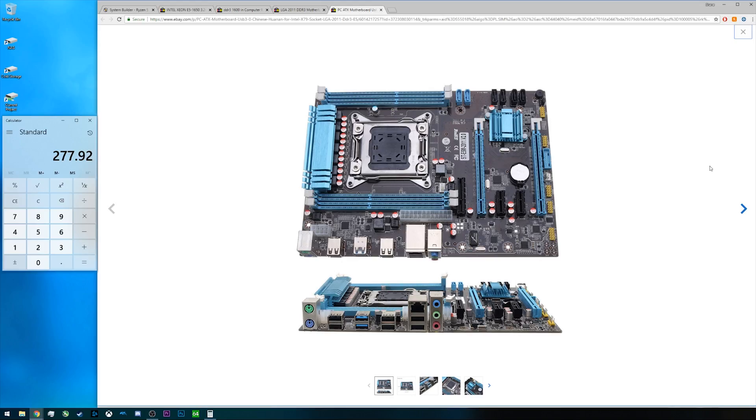Compared to most B350 boards you're also giving up USB 3.1, however that's something you could always add with a PCIe card if you have the slots available. That's less of a big deal than losing NVMe, but it is something to be aware of if you want to add a USB Type-C port. My recommendation is that unless you really need the extra data transfer speed, just get a Type-A to Type-C cable — especially for a phone, you're probably more worried about charging than file transfer. But if file transfer is important to you, absolutely invest in that add-in card.